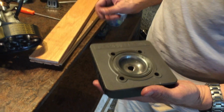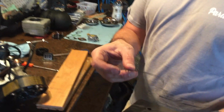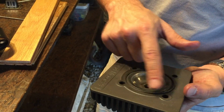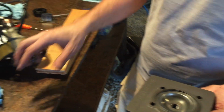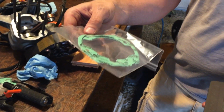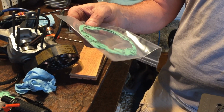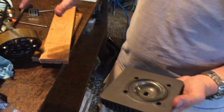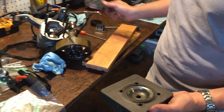With the new head gasket, we'll take a little bit of AMSOIL or any oil that you guys run in your engine and just lubricate the head gasket. You also want to lubricate the base gaskets as well. It's super important. So lubricate the base gasket on both sides and then put it on over the engine. And then you're going to lubricate obviously the piston really well.